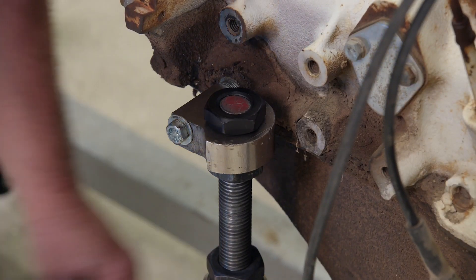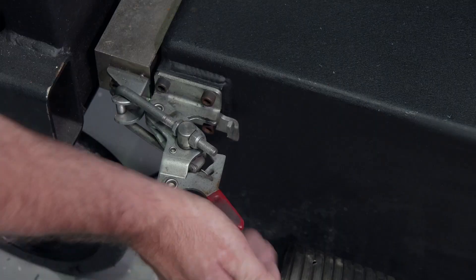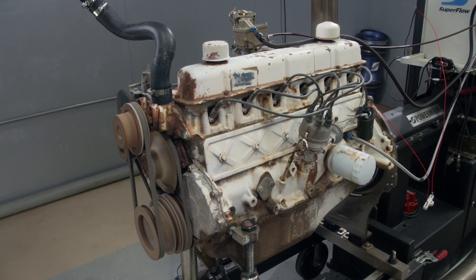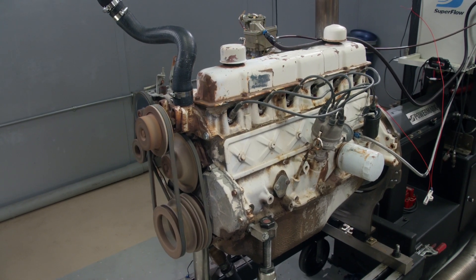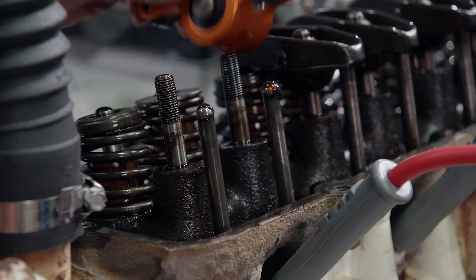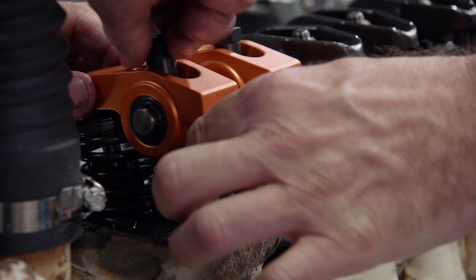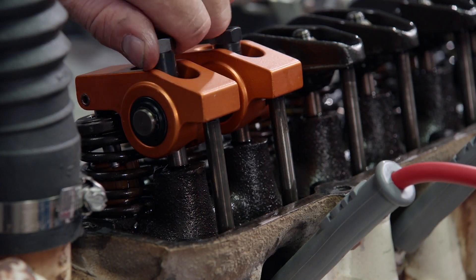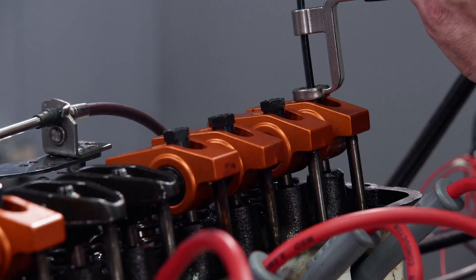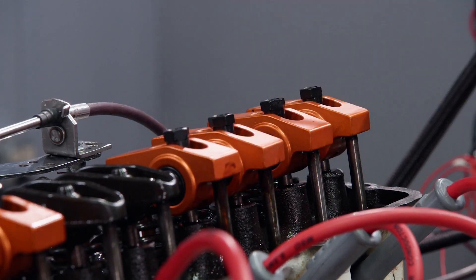We've been working on an engine recently that's generated a lot of enthusiasm and fun around the shop. It's an old Ford 300 inline six that was running an industrial water sprayer. We coaxed 88 horsepower and 217 pound feet of torque from this power plant. Several upgrades including induction, ignition, carb, and valve train improvements resulted in 169 horsepower and 280 pound feet of torque. We're still searching for more power, and to do that we'll need to do some machining such as cylinder honing — of course, we'll need a torque plate for that.